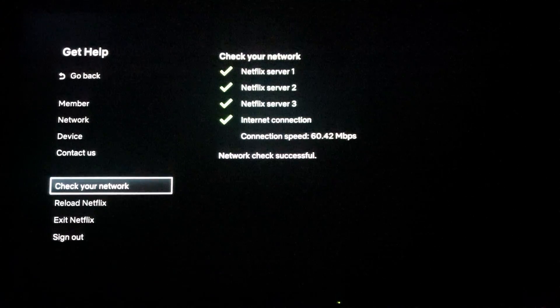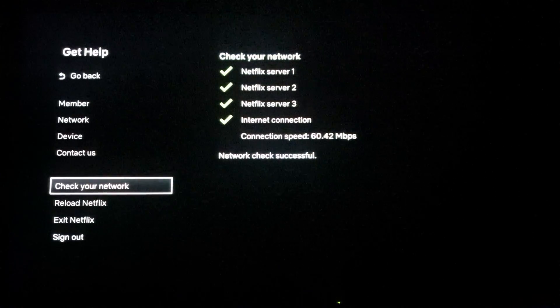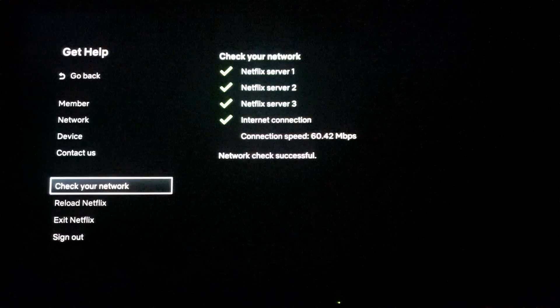On Wi-Fi I'd get anywhere between 18 to 20 meg if I was lucky, and more averagely about 10 meg. So I've lost about 50 meg just because of the floor levels and going through walls — insulation, steel beams, they can all affect it. Interference from fridges, radiators — wireless internet is just a bit temperamental.